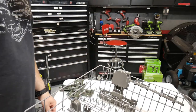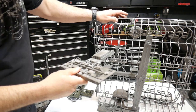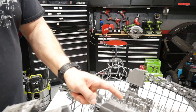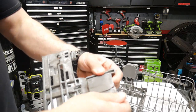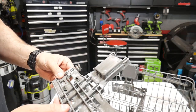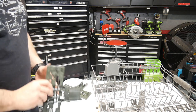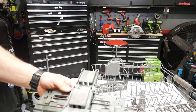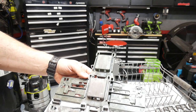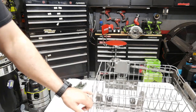There's the clip that was holding it on, and this whole assembly just pops right out. There's a lot of nasty stuff in there to clean out. I just noticed as I pulled this out that this part's cracked too, so I'll probably go ahead and replace both sides since I've already got it out of the dishwasher. Let's go ahead and compare the parts — looks about the same size, everything looks pretty good.